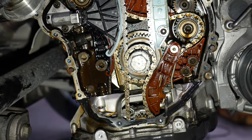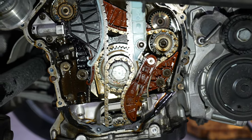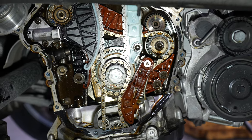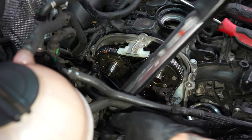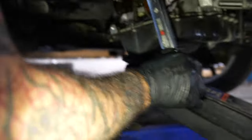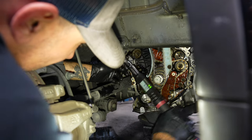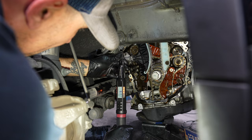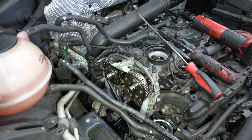So we just installed the oil pump chain — that T30 right there. The lower chain is called the oil pump drive. And we did the slide for the rail next to it — that's the tensioner. Got to torque down the rails: 20 newton meters on the rails, 9 newton meters on the tensioner, and 9 newton meters on the oil tensioner. Double check all your marks.